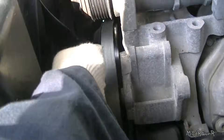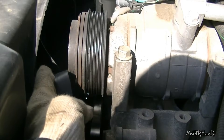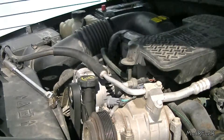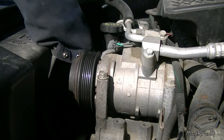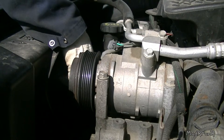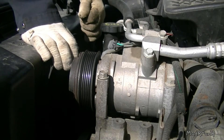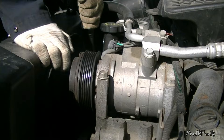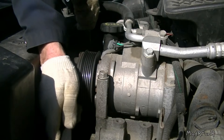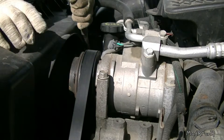The last thing you need to do is get this part on top of the AC pump and then you're done. Put the breaker bar — or I call it a Johnson bar, I've been corrected — back into the square hole in the tensioner and pull towards the passenger side. Make sure that the belt stays on everything where it's supposed to, and bring that end up.